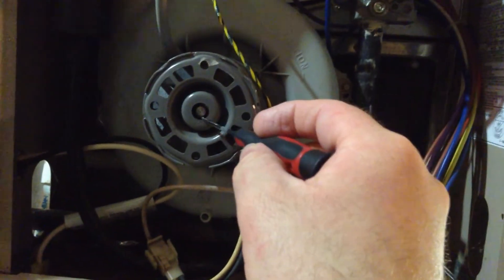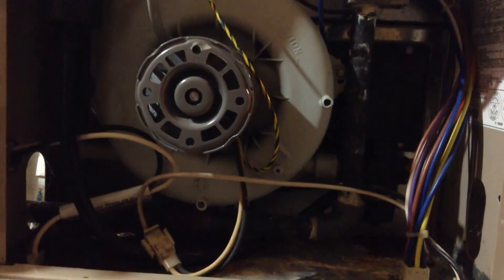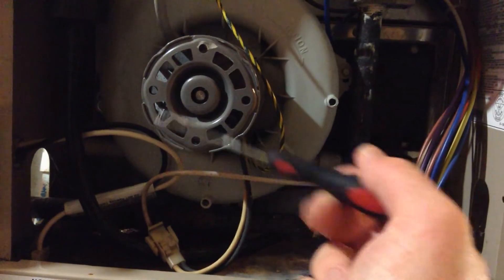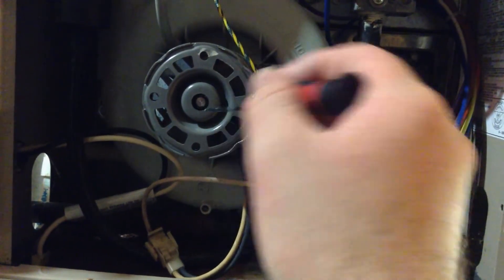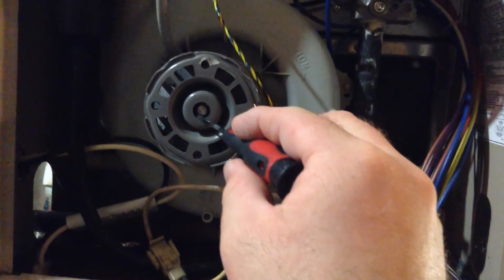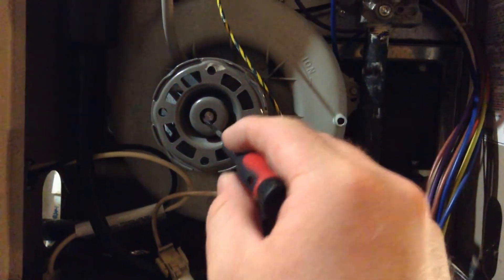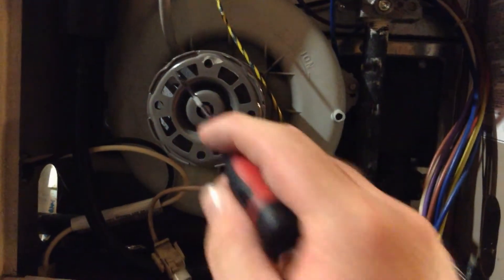Here's the grease gun. Go in at like a 45-degree angle. This is helpful to have two people holding this thing, and the grease gun can be a pain — but it is doable with one person. 45-degree angle, go in, you'll feel it contact the ball a little bit further, and you can kind of feel it roll over and hit the outer race, which is pretty far in here.